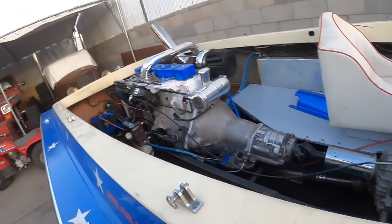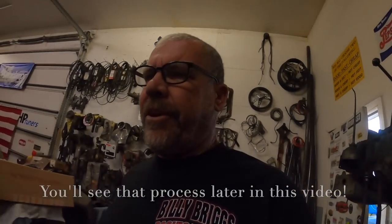We're going to pull the transmission out and take the valve body to Phoenix. I've got a guy down there with a valve body dyno, so we're going to dyno the valve body and see what's going on with it. I'm missing a channel somewhere in the valve body to allow governor pressure to force it into the next gear. I know they mechanically shift with an open gate valve through their passages, but if the governor pressure isn't reading correctly, they won't shift. The governor has to be bypassed internally, and that's where I messed up, I'm pretty sure. So we'll get that out and I'll keep you updated when we head to Phoenix.